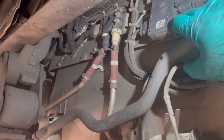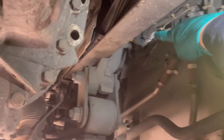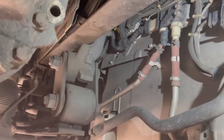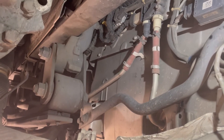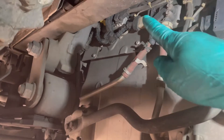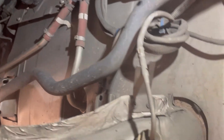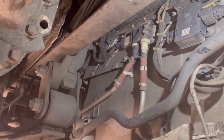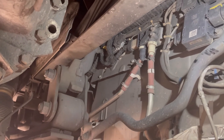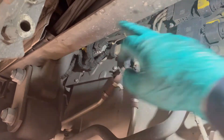These are the other two sensors. That one there is the particulate matter PM sensor, and that one there is the NOX after sensor — two 8mm bolts holding each of them in. The NOX after sensor, the bottom bolt is okay but the top one can be a bit fiddly to get to. Both sensor looms come around onto here. Pretty easy overall — not a majorly hard job — just that top-left bolt on the NOX after sensor is a bit of a pain to get to.